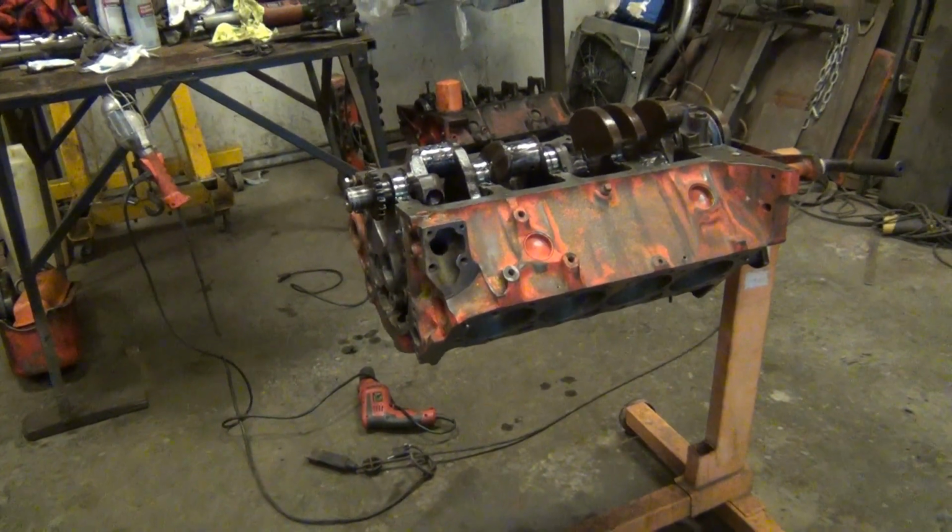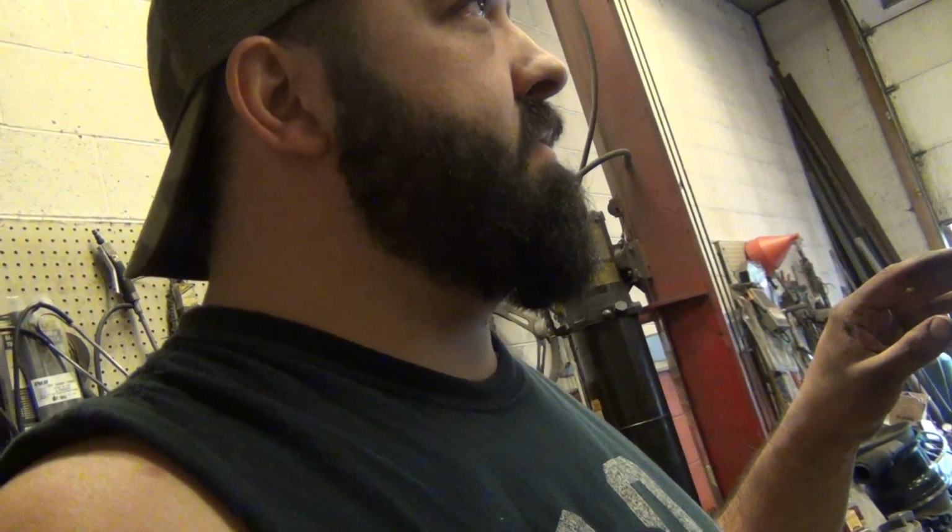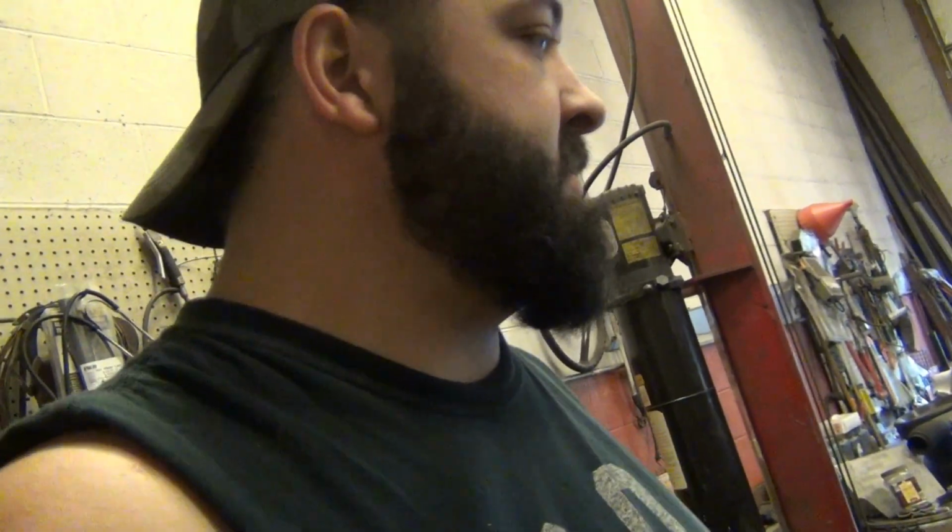There's really no need to go any further than that with the cam and the heads that I got for it. It'll make the power at that RPM where it normally would with a crappy set of heads or a smaller cam, you know, 8,200, 8,300 RPM. When I had an engine like this, I'd had the little Dookie, it's probably like a 540, 550 lift on a 106 lobe separation. Flat tappet cam. I had terrible heads. I had hump heads on this. And it run good. Like, it broke all kinds of stuff.